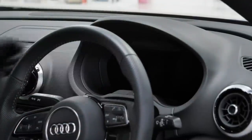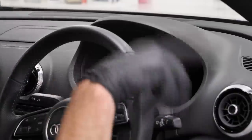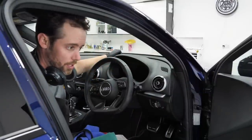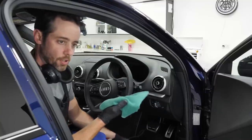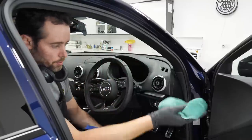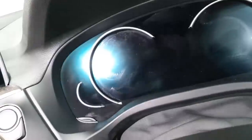When it comes to the dials and the clocks, if it's a recent modern digital display like this, or just the Perspex with the analog clocks and dials, I often see people who have washed the car down and done the interior themselves use a damp APC cloth, all-purpose cleaner, an interior cleaner, to wipe over the steering column, the dashboard, the doors, and they go over the screen. And it's going to smudge, it's going to look awful. And it does look awful.